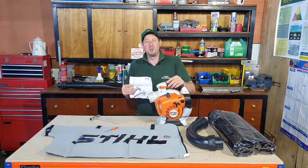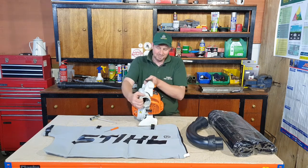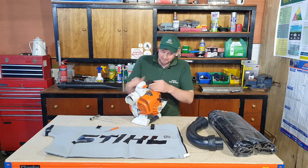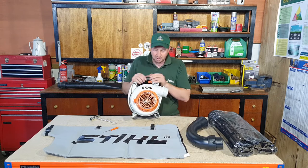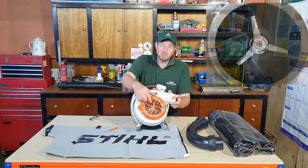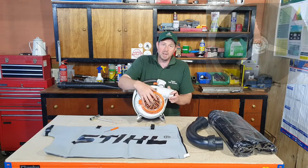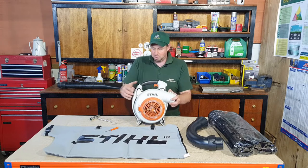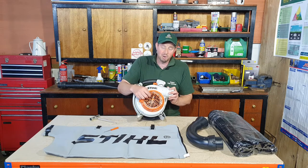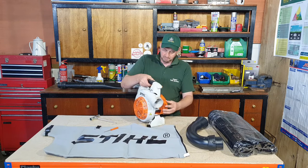There's nothing like watching somebody do it in real time. That's where the air will blow out into the bag - that's the other side of the engine - and this side is where things will get sucked in. On this SH86C you'll notice there's a serrated metal impeller in there. When we're sucking up debris, it'll all get pulled in, cut up, and then blown out into the bag. It's vitally important that the machine has the metal impeller or it won't do a very good job - you'd end up clogging the fan and breaking the machine.